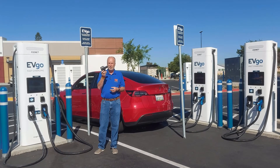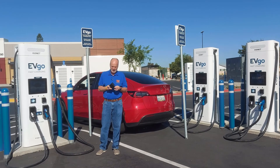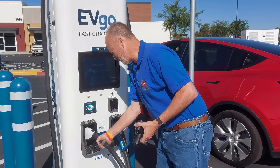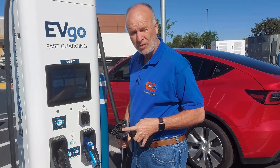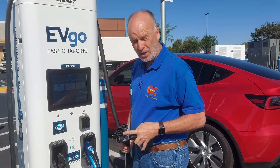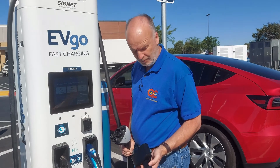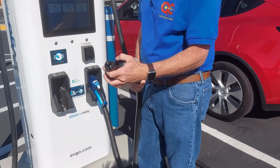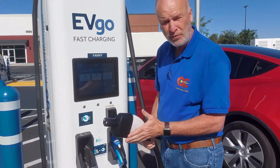This is the adapter. It came from South Korea, but I want to thank Tesla for making sure we could get this. We're going to show you how to charge on this charger. First, remove the plug. The top half looks like the J1772 plug, called Type 1 in Europe and J1772 in North America — it's from Japan, believe it or not. It was a Yazaki design. This is just going to be plugged in first. Make sure there's no debris in anything. It clicks together and has to go together first before you plug it in the car.